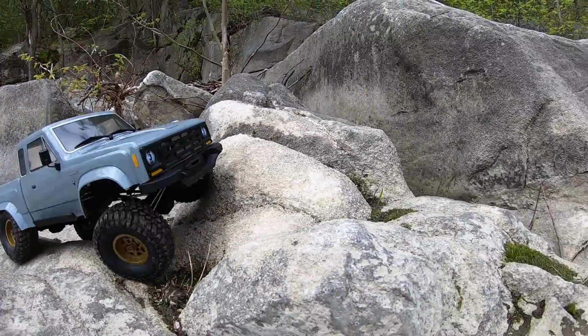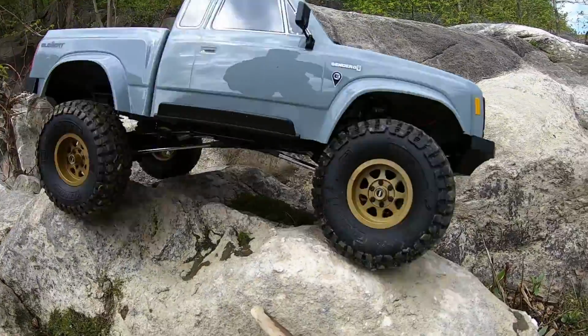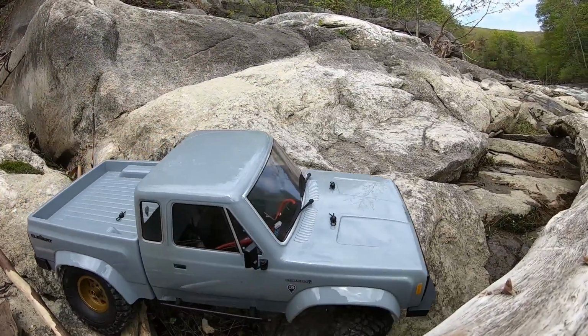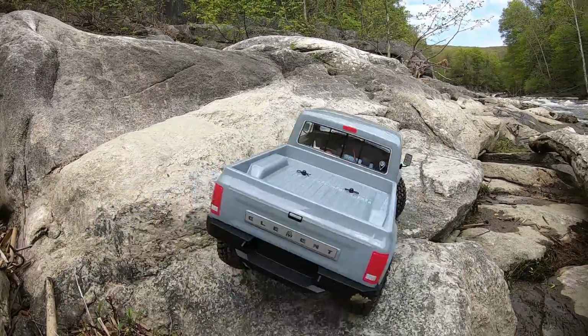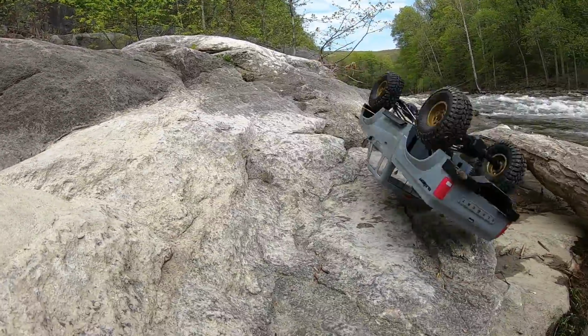It's not a durability issue, but it's the bumpers. The bumpers are pretty big and they hang kind of low in the front. And I did hang up an awful lot on these bumpers. I noticed that I could probably push the front bumper back a bit, drill some new holes, and that will help me set the bumper a little bit farther back for a better approach angle. But that's really the only issue I could find with the truck, and that's pretty easily remedied, maybe with some aftermarket bumpers or something like that.